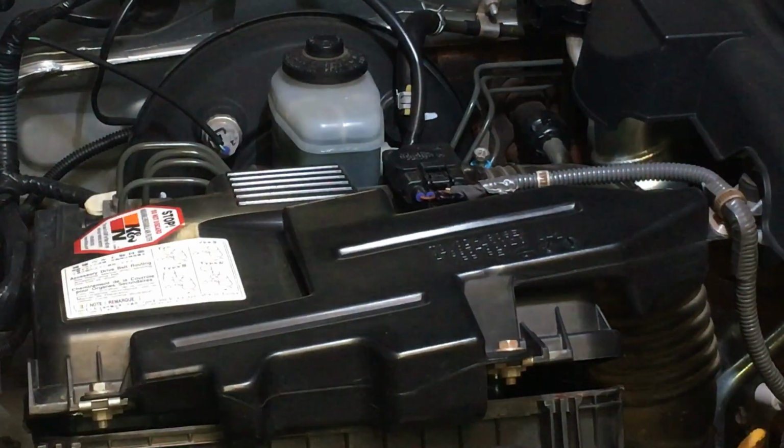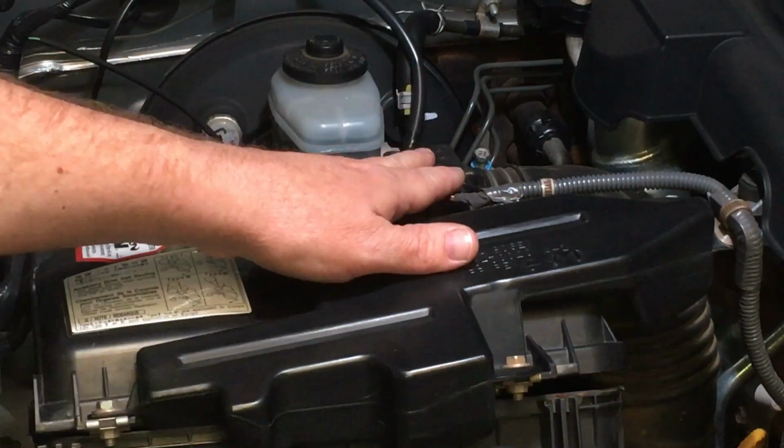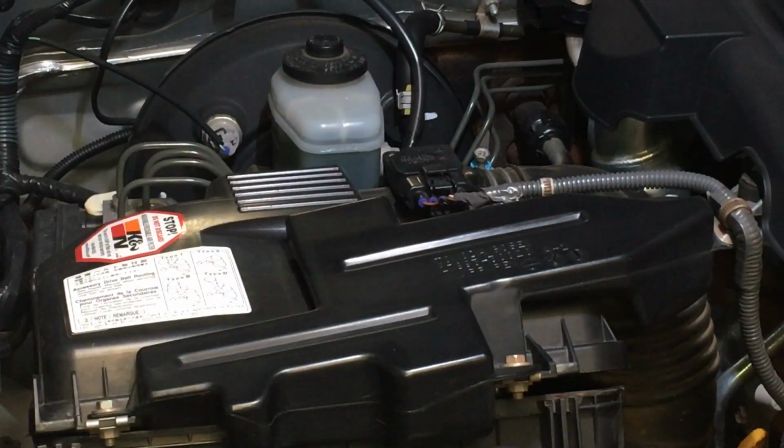Oh, look, there's no point me hanging around, keeping the video going, I suppose, to show you how to oil a K&N filter. That's a separate video. We're just going to use the spray can, a little bit more red on there. We're going to put some red rubber grease around the outside to make sure it's sealed. Close it up. Might have a quick look at the MAF sensor. We've got a video on that. Just make sure it's clean. Just start off the season and make sure we're in peak condition.